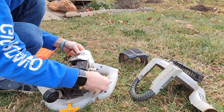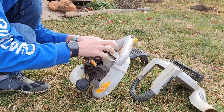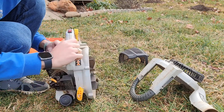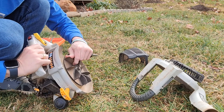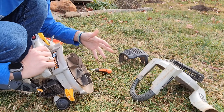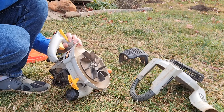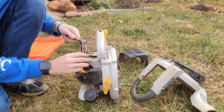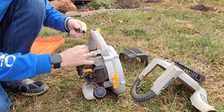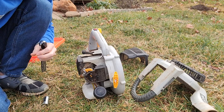Now that we've got that off, you can take off the spark plug boot right here. The next thing we need to do is take out the spark plug — I'll use a 19mm socket for that. We need to bind the cylinder because if you put your wrench on the flywheel to get it off, it's just going to spin forever.